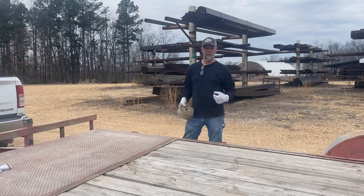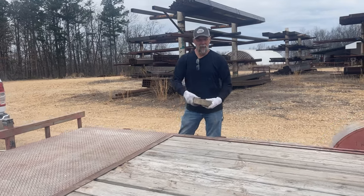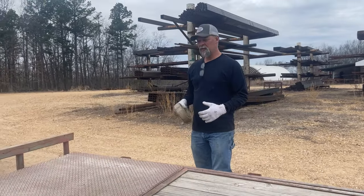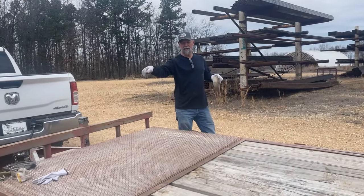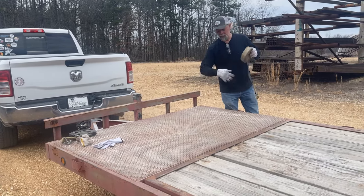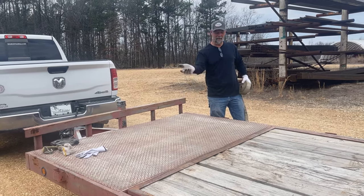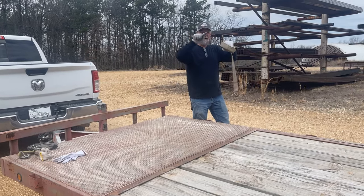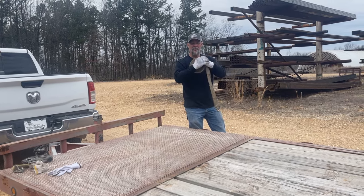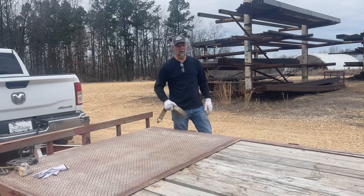The way that I load material on a trailer — that's some valuable info. When I roll my strap up, I've got the hook out. That way, when I fling this at Joe, the strap hits him and not the hook. I like my ratchet on the driver's side and my hook on the passenger side. I'll throw this over and get it on the trailer first. Then whenever I get my material, I'm stacking it on top of my strap — I've already got my strap in place. I can pull it over and hook it, pull the other one over, ratchet it down. Now my loop is going over the top, under the material, and then over the top again. So it's not only squeezing the material together when I ratchet it, but it's also pulling down on the top of the material, which holds it down. Then you don't have to put a bunch of blocks and a whole bunch of crap on there.